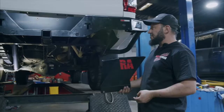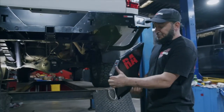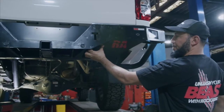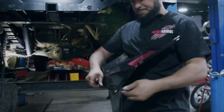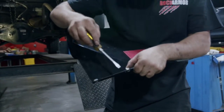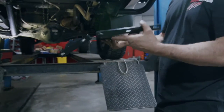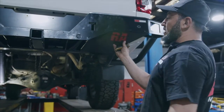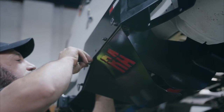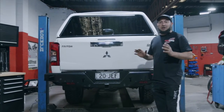Okay, here we go — I've got the bar in place, all my bolts in there nice and tight. Now it's time for the bash plate. The bash plate is going to sit under there like so. I'm going to put these capture nuts in — just with a screwdriver they clip in. Go through, put them all in, then mount it in place and with my allen key bolts go through and tighten them all up.